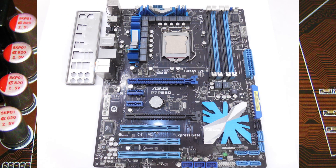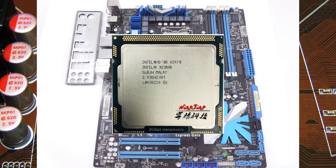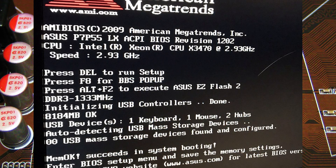I need to say one more thing. The ASUS P7P55D doesn't officially support any Xeon CPUs, so I wasn't 100% sure if the X3470 would work with my motherboard. But as it turned out, I didn't even need to upgrade the BIOS version. The Xeon CPU was identified by the board as soon as I installed it and turned my PC on.